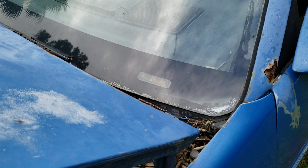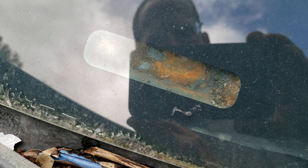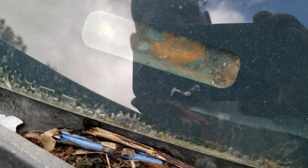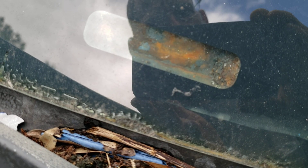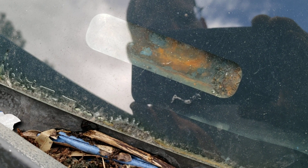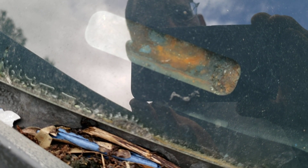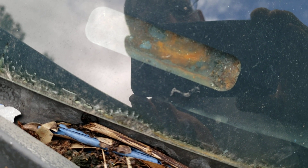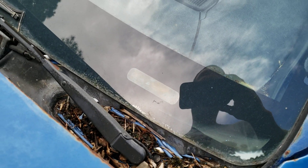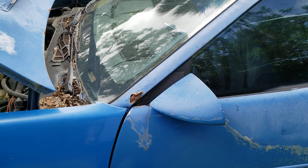Outside of buying them for parts, if you're buying one you actually want, the very first thing you need to look at is whether or not the VIN number is rusted away. That little pocket it sits in just fills full of water. Any kind of water leak and it rots out the VIN. On this one, the VIN is completely gone, which makes it a parts car. It should be black with GM stamping. If you can't read the VIN, it's not worth buying — you're not going to get another VIN issued.